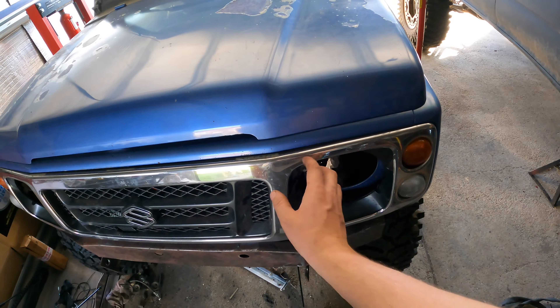I started with a 25mm cut out of this side, and the grill separated — 25mm cut out of the grill. It's pretty subtle but it should help a lot with tyre clearance. I'm using this little plastic stapler to join that side of the grill back on. I'll have to do the same to the chrome to put back over it. It's a pretty cheap tool and we use it a fair bit for this sort of stuff.